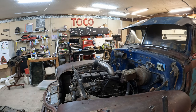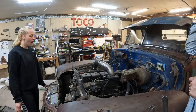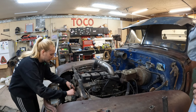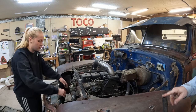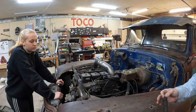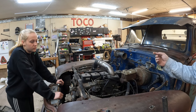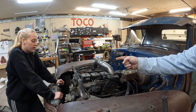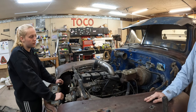That's going to include our Heim joints on either end, which are going to be adjustable. So what we need to do, Caitlin, is get some Heim joints fixed in the end of one of these, welded in, at least weld the nut in, screw the Heim joint in, and attach it to our cross member here. Know what I mean? Is it still going to be locked?